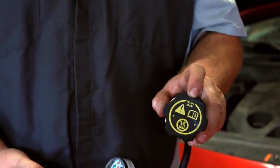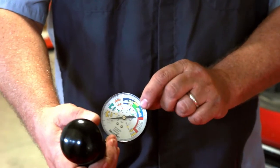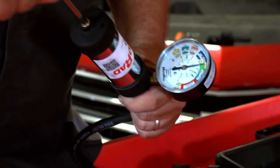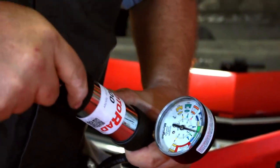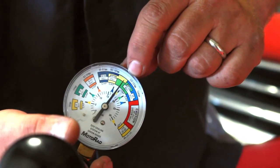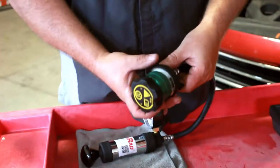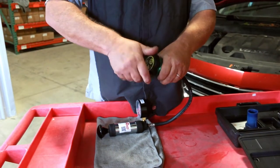Note the pressure on the cap — this is where it should relieve pressure, shown on the colored band on the tester. Pump the tester. You can see this cap is within the specifications. After testing, before removing the cap, release the pressure, then remove the cap and adapter.